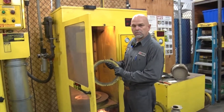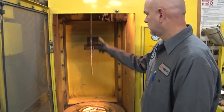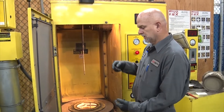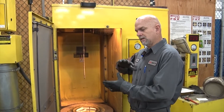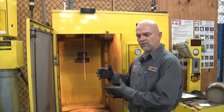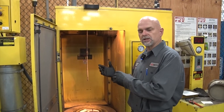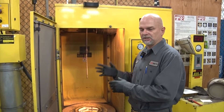You put the appropriate plate on there. You got air nozzles in here that blow up and down, and they blow air on each side of the filter. The exhaust comes in the filter and you got membranes or cell walls and it actually filters through there. The soot doesn't go through there — that's why it collects. Then it turns it to ash and you got to blow it out.